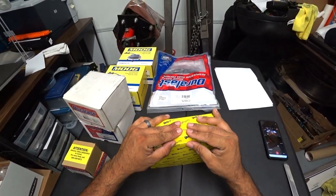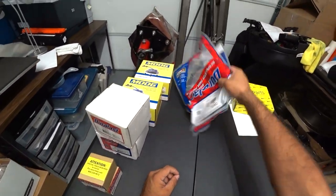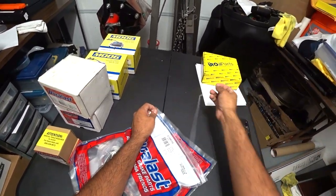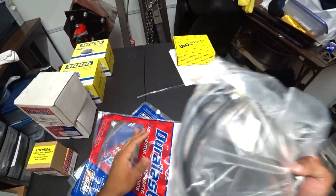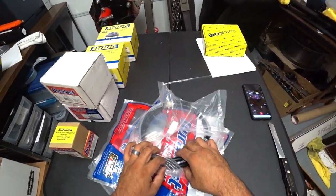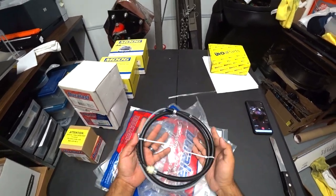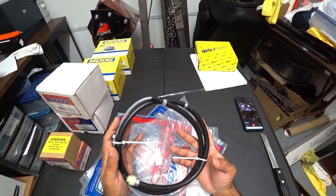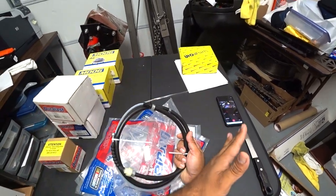These are going to be quickies — things we can do in under five minutes. This next one is a little bit more thorough DIY. These are the brake cables. Ian's Red Jetta has been having issues where the cable isn't doing its job anymore. This is a common problem with 20-year-old cars, a.k.a. Mark 4 Jettas. We ordered brand new handbrake cables for the left and right side. You always want to replace these in pairs because they stretch, but they don't stretch equally.